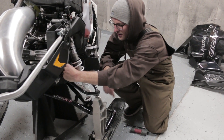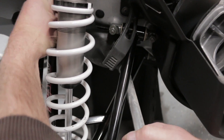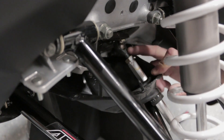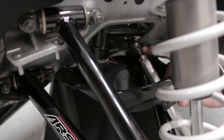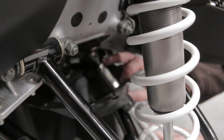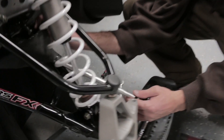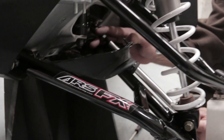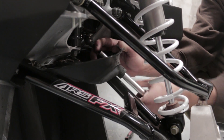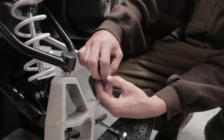On the left side of the sled, remove the rubber boot that houses the tie rod — just a couple of push darts and Torx screws — to get much better access to the inner end. Here's your steering column and the opposite end of the tie rod inside the chassis, with another lock nut and ball fitting. This stays intact — just unthread the old OEM tie rod from the lock nut and thread the new one on. Spin the tie rod to the left to tighten, going just a few turns so it's fully biting on thread, then attach it back onto the spindle.